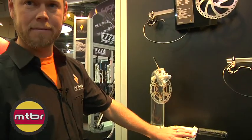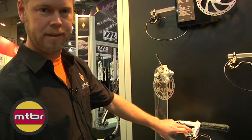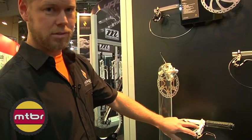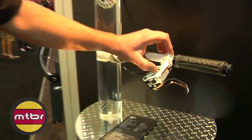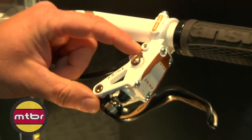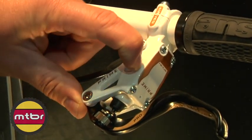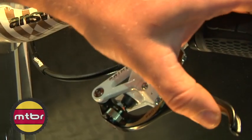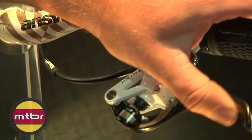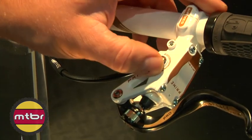The primary focus of this brake was to get Hayes a stroke adjust feature and user-friendly adjustments. So the main feature is our new poppet cam system. It's a 180-degree rotation at the master cylinder right on top, easily accessible with a glove on, and what it does is it allows the rider to tune the amount of stroke that the brake has.